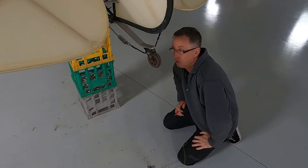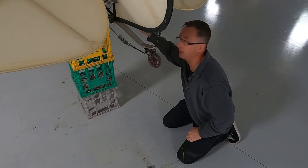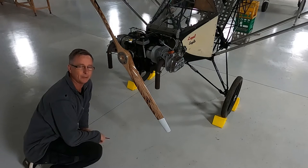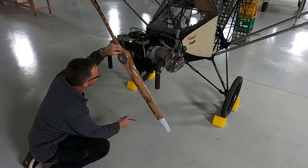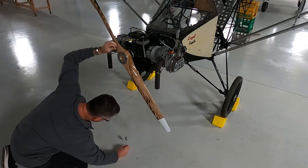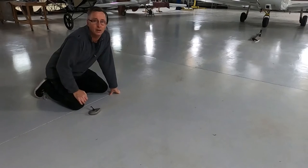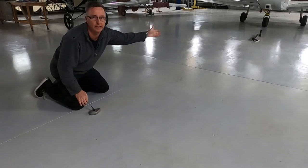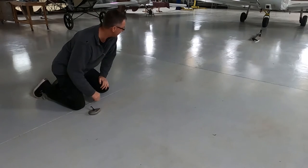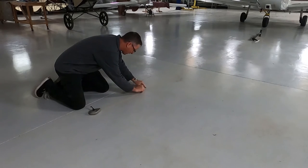All that's left to do now is join the dots. I'll move the aircraft out of the way, string lines across, and we can take physical measurements of how far it is from the tail wheel to the datum and from the main wheels to the datum. From that we'll be able to calculate where the centre of gravity is on the aircraft. I almost forgot to do the centre of the aircraft from the very front, so I'll do the front now with the plumb bob — centre of the prop, down to the ground. Centre done. Now I've strung out the chalk line and the line is lined up with the dot on the concrete where the tail will touch, with the centre line off the prop.